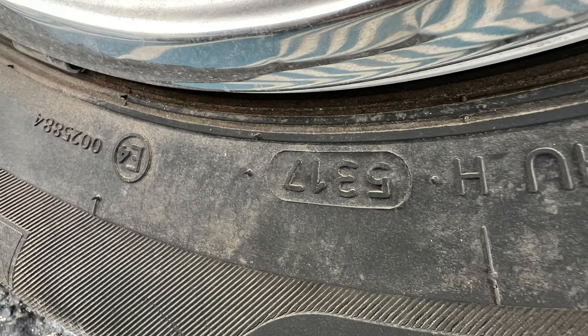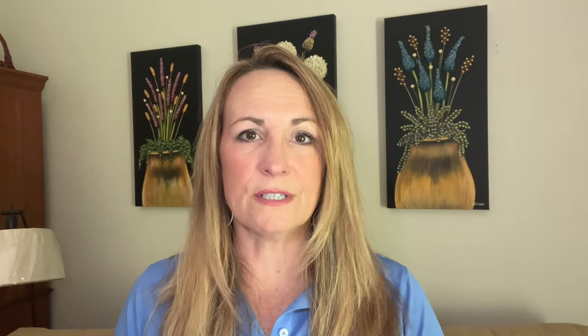The next thing I want to talk about is tires. RV tires are really important to change out every five to six years, and you want to look at the DOT date. Sometimes you can be told that the tires are good and just go by the word of whoever sold it to you, when in fact the tires actually need to be changed. Look at the tread, look at the date, and make sure there are no cracks in the sidewalls.